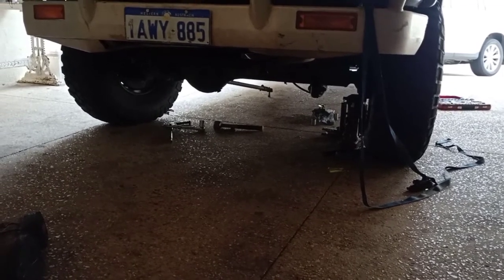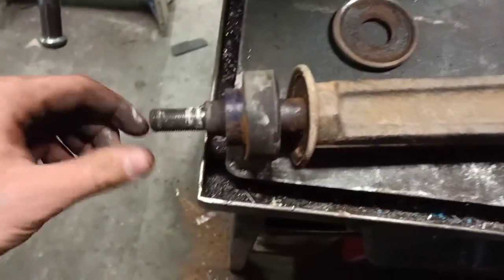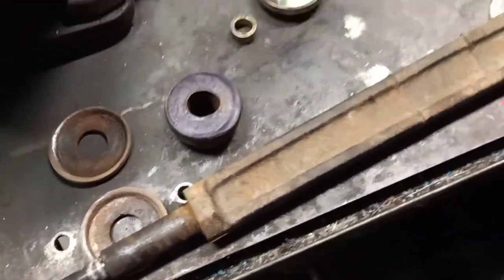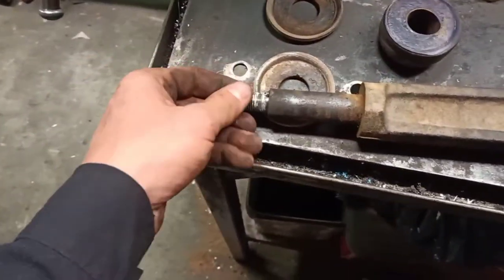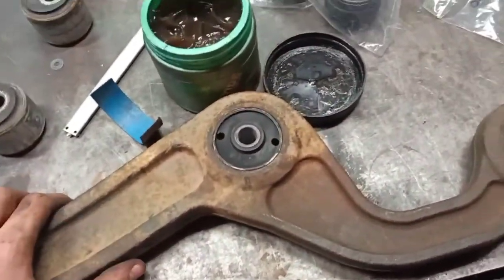I've chucked the left-hand side one in — that was the first one I did. I've pulled out the driver's side. I won't film it but I'll quickly press the bushes out, press the new ones in, chuck the new spacer on, and put it straight back in. I'm running out of daylight. A trick for when you install them: get the bolts in with the nuts on and leave everything loose. I like to tighten the main pivot bolt first, then tighten the other mounting points. If you tighten any of those before you've got all three pieces together and aligned, it doesn't want to move and you'll just be fighting it — it's already a bit of a tricky job, so try and make it as easy as you can.